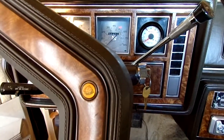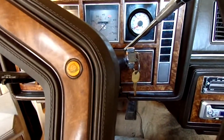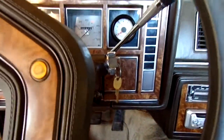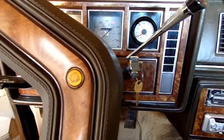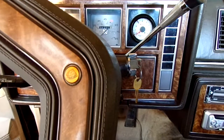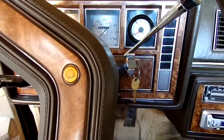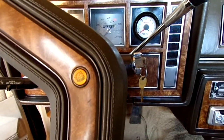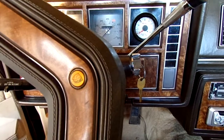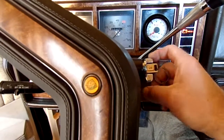Now I'll pump the gas a couple of times and we'll be on fast idle — then start it up. For fuel-injected cars, I also have a switch under the dash that lets me turn the fuel pump off. I crank the engine over with the pump off, then turn the fuel pump back on and it starts right up. This car, started only once every three months, runs the same as it always did — and that's been 12 years now with never a problem.